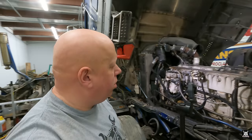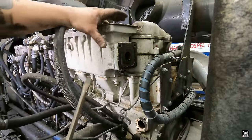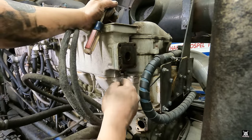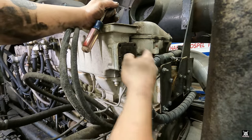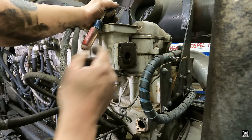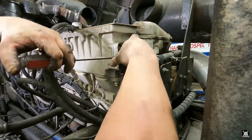All right, next step, taking them water manifolds out. So I guess we'll start with the back and then work to the front maybe? Not really sure, we'll figure it out. All right, so this is either ingenious or incredibly careless, one or the other. So this gasket here is for water, okay? What all it does is it takes water from out here into that tube going down back into the engine block down here. Between this and this housing are O-rings. So this piece will pry out. Hopefully, comes out easy.